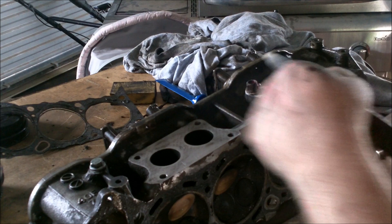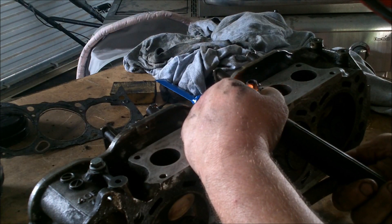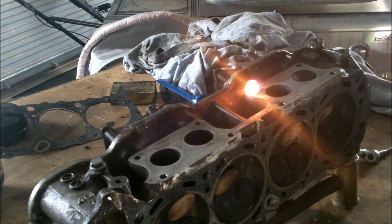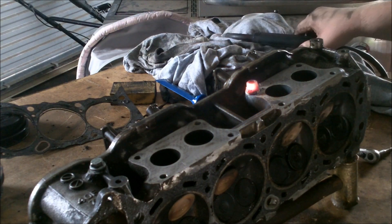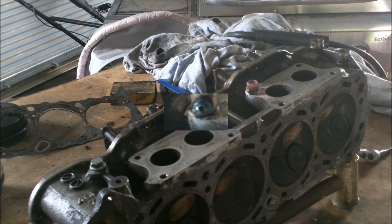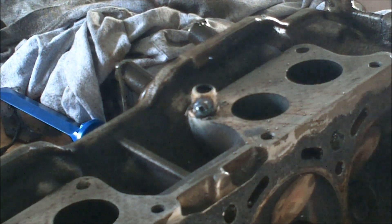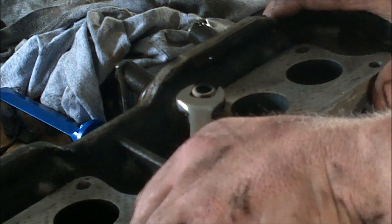Tack it in a couple of spots. Be careful not to weld into your aluminum. Let's get a pair of vice grips or maybe a wrench, go on there, and see if we can get it out. That weld doesn't have to be beautiful — that nut I was trying to weld on there was rusted, so it's got a lot of slag. Let's try it.